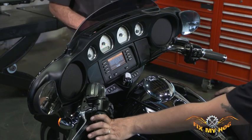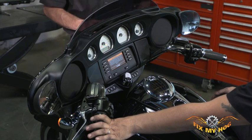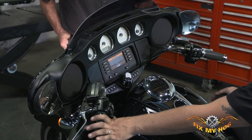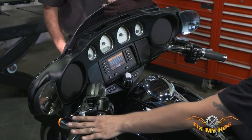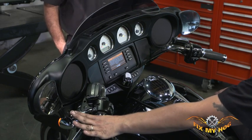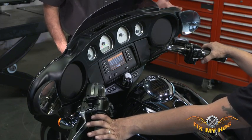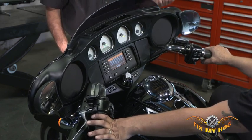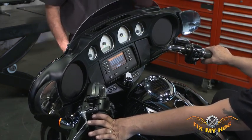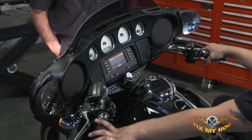Once that is enabled, you can go through all of your testing for the components that will enable or disable cruise control. Check the clutch lever — as you pull it in, the amber light should turn green, showing you've got proper function. Do the same thing with the front brake lever and also the rear brake pedal. You'll see the amber light goes from amber to green. You also want to roll the throttle forward, which will disengage the cruise control.